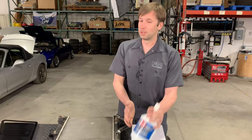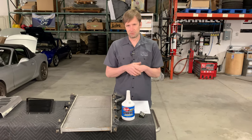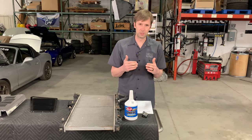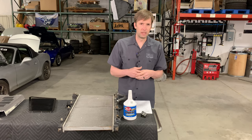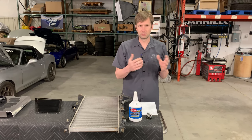So what is too hot? Generally speaking, if your coolant is 230 degrees Fahrenheit (110 Celsius), then it's time to do something. You need to pull out of it, turn the heater on, turn the air conditioner off — whatever — to try to decrease that heat load. For the oil, it's going to be 280 degrees Fahrenheit (140 Celsius). At that point, if you're using high quality synthetic oil such as our Redline, the oil is totally fine, but your seals do care about that temperature and they're going to start to fail. Once you progress beyond that, surface hardness of the metals in your engine can degrade, fail, and create longer term issues.